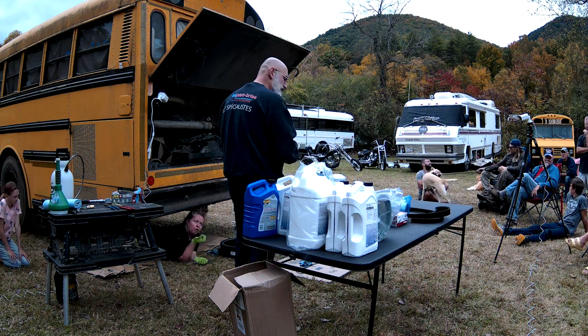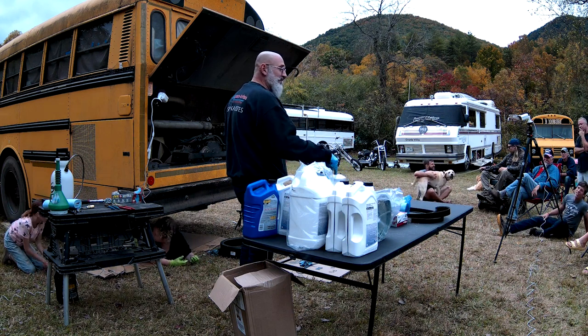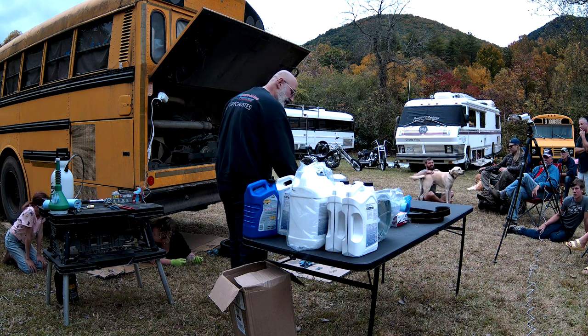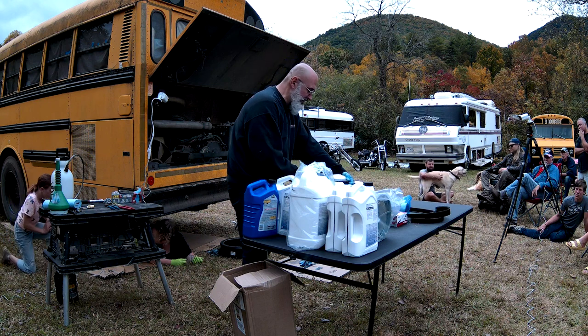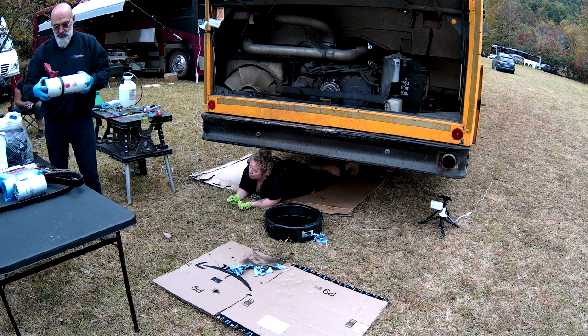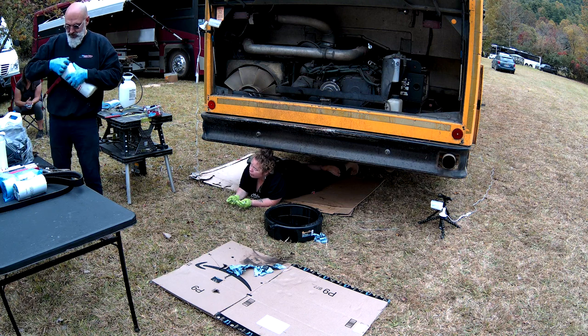There are some that go on the bottom and turn. They don't make them big enough for this type of filter. They're meant more for automobile filters. And with a long filter like this, you want to grab your filter as high up on the filter as you can. That way you're putting the torque where you need it.